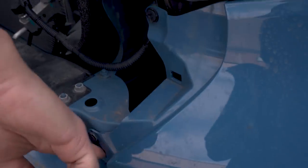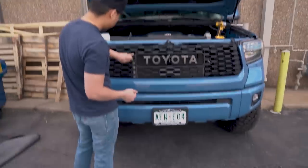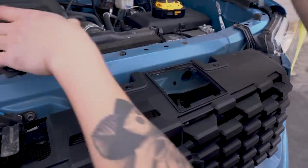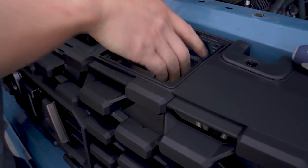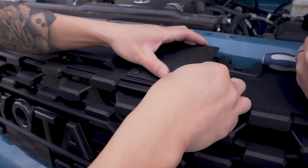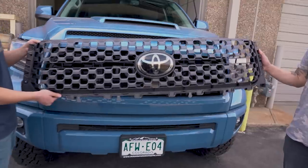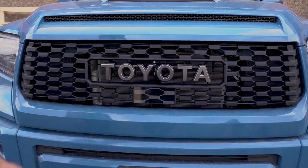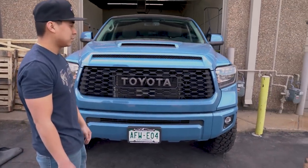So here we have it — let's get this thing back on. We just line up these holes with these pins. This little door lets us access the harness underneath. Pop that open, clip that into the frame there, and then we'll plug this in — there we go, you hear the clip — and then put the little door back. Here's the new pro grill, and this is the OEM sport grill. Pretty big difference there. TSS is on there as well, so the TSS system will work. And it looks really good — matches with all of our blacked out emblem and black tailgate insert.